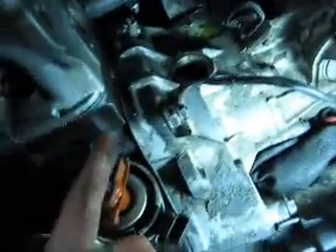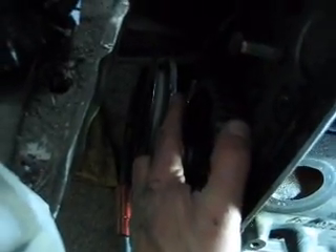It's about getting this one pointing to the cable that goes to spark plug number one. This mark needs to be here, and the intermediate shaft — the dot has to be aligned with the mark on the pulley.